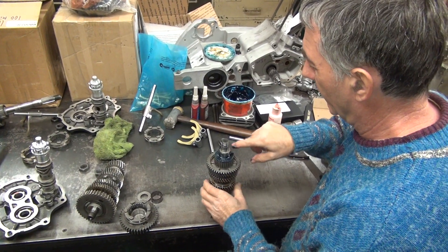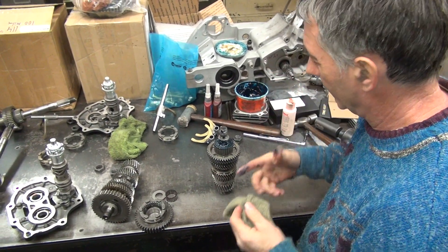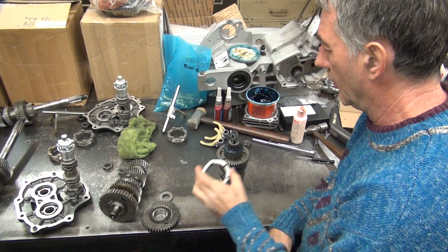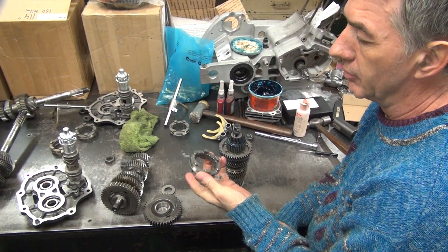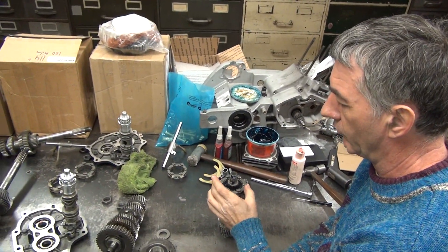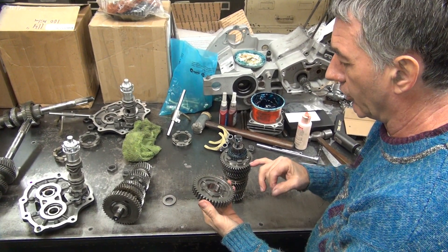Make sure it does not move because you will have hell — you'll press the whole transmission together and think it's together, and then you'll have two gears clapping each other. Have we done this before? Seems like it. Bearing — plus the grease is good for your bearings. Don't forget the dog. I don't think it's directional — looking at quality of dogs. I'm gonna put the better ones toward the big gear because I think that's second; this is low, right?